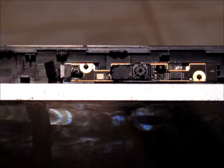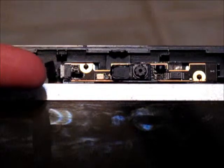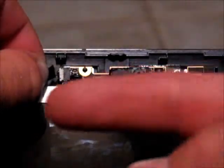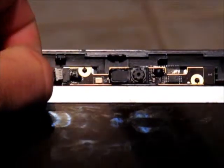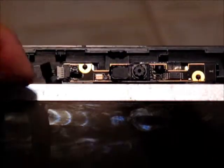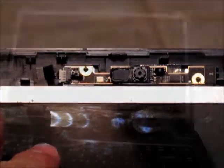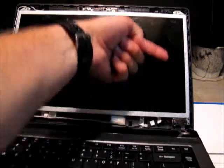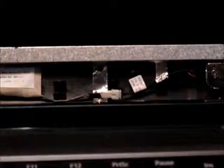The wiring for the webcam is a little ribbon cable coming in from the left-hand side. Carefully grasp the ribbon cable and pull it out in that direction. The rest of the ribbon cable is adhered to the back side of the screen with two-sided tape. Now we're going to disconnect the little white wiring connector block that connects the wires to the microphone. These are very delicate wires, so carefully pull the little connector out of its bracket and very carefully separate one end from the other.